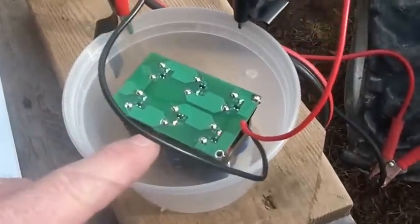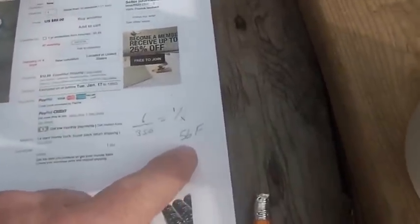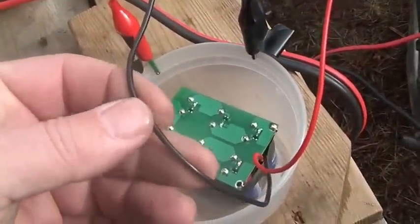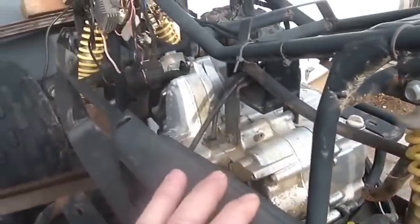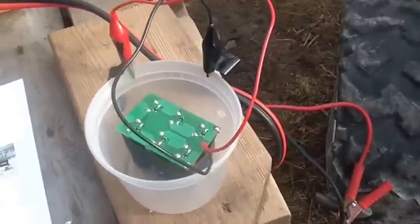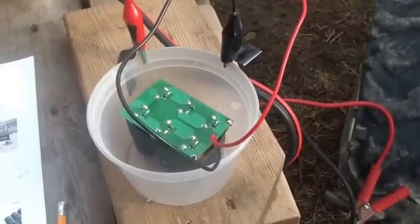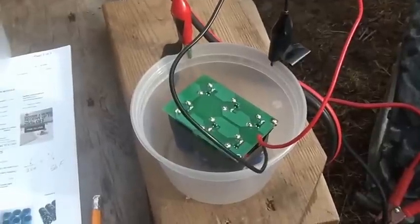So you have two to three times the amount of money tied up. I have two versions here. This little guy is about 16 and two-thirds farads; this bigger guy is about 56 farads. I've tried this little one on 110cc motors and — the wires are kind of small — it didn't have enough chutzpah to turn over one of these little motors. This one was pretty cheap, like $20.